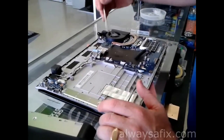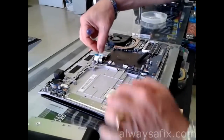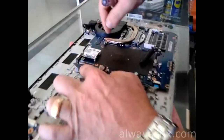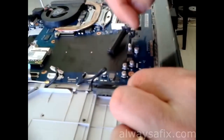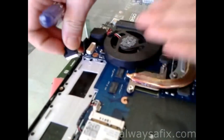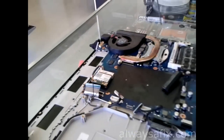Once you've got the back cover off, there are a few cables that you need to unplug. Unplug the two cables that go to your Wi-Fi card. This is your keyboard cable that plugs in the back here. Then there are a few other ribbon cables along here, and take out the cable that goes to your screen.